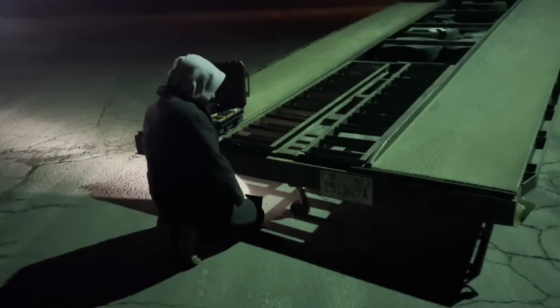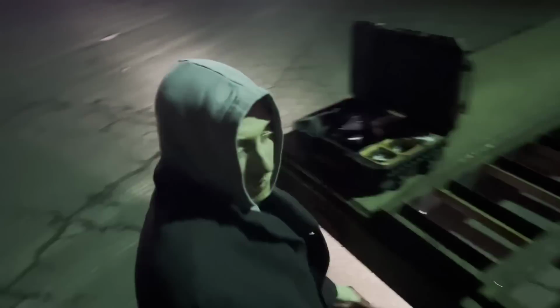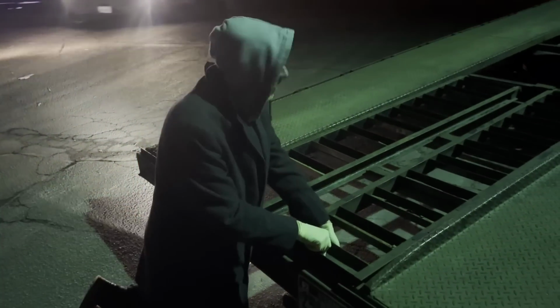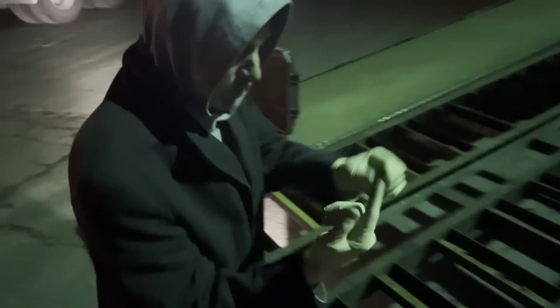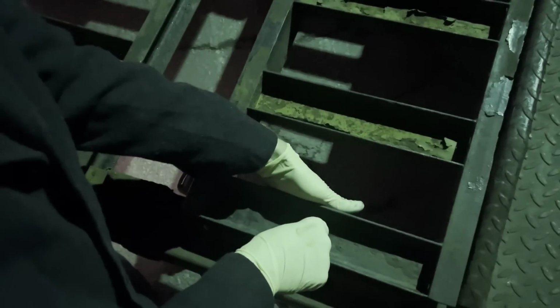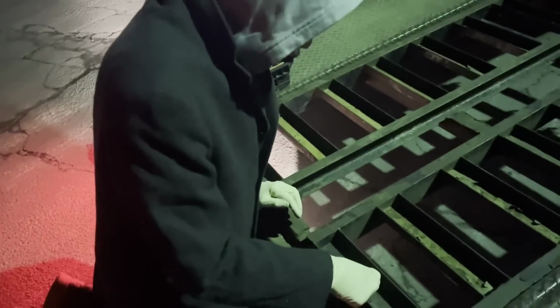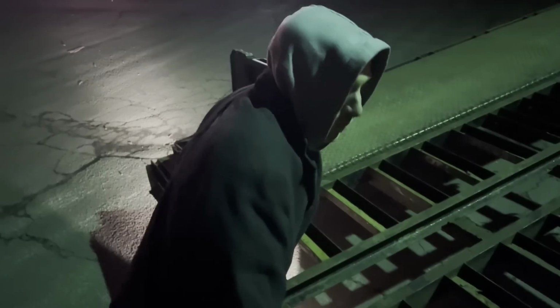Pretty simple. Also, another problem we've had in the past, I designed these ramps to sit in the frame rail, and then we just use a bolt in the back to hold it. Well, if that bolt falls out, then the ramps can jump off. So we have these bolts in there, but what happens is the nut will start to walk off as we drive. They were almost all the way off, and we tightened them when we left the shop, and we've only been driving for like 3 hours, if that. So I really need to tighten these up pretty good so we don't lose those. We don't want to lose a ramp on the freeway.